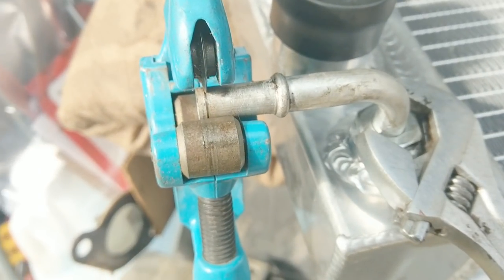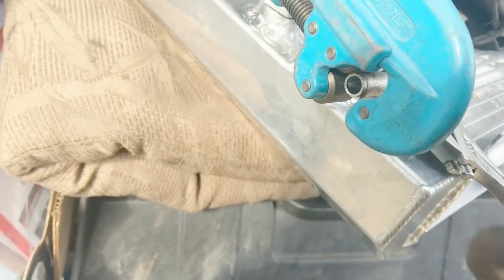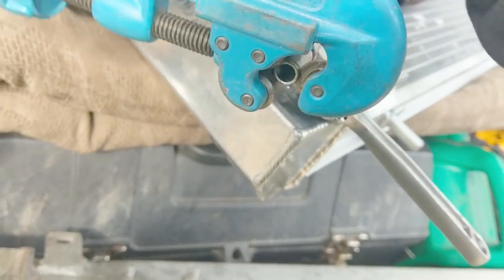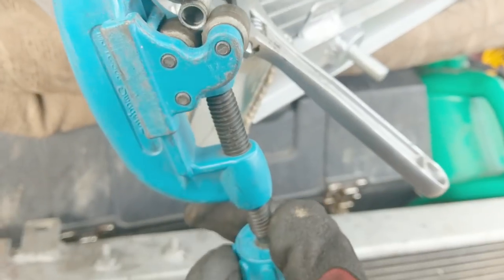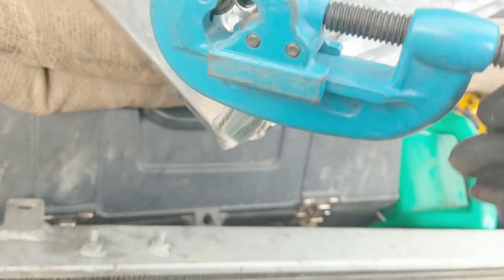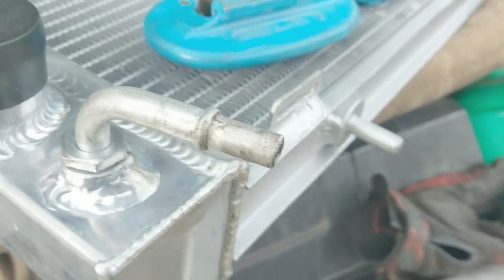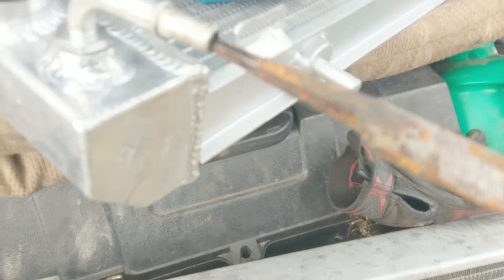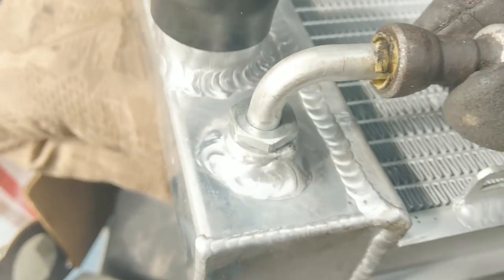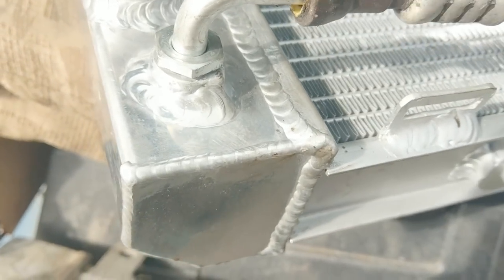Let's just nibble a little off there. Have you ever seen one of these little circular pipe cutters before? Really nifty — give her a spin, crank it a little. I think my dad said this was for stainless steel or something. Just keep doing that until she comes off. I'm going to clean it up with a file. Beautiful. Did you know the pointed end of a file can be used for holes? Really good deburring. Keep your holes clean. So now with a little fiddling, the fitting actually stays on there — transmission line is not going to blow off, at least the lower one.